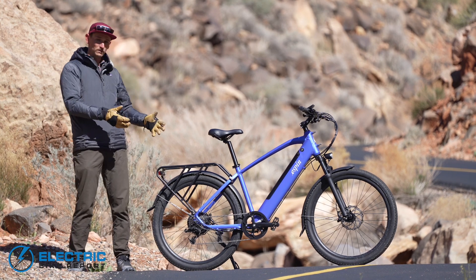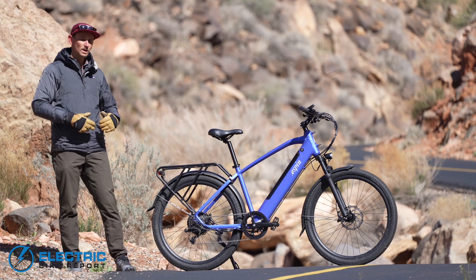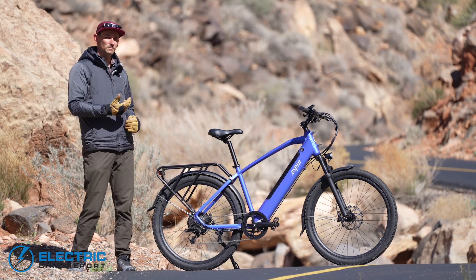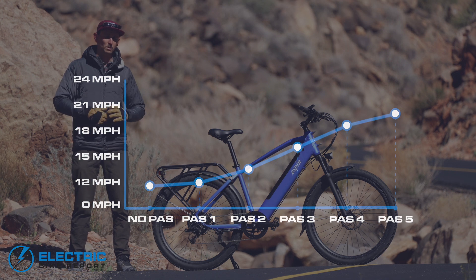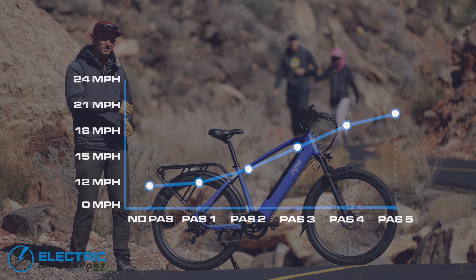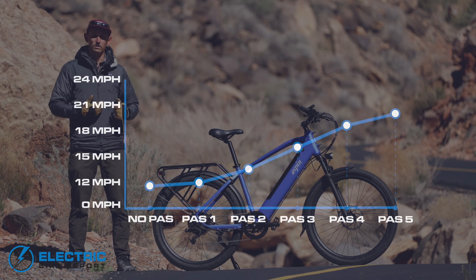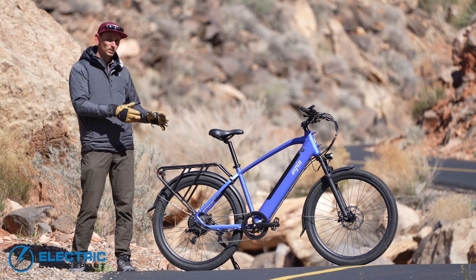The Eastman Sport's 500 watt rear motor is very fun — it's got a lot of pep, creates 65 newton meters of torque which helps its ability to climb hills. Moreover, it's just a quick feeling bike. It's limited to class two speeds, so 20 miles an hour in both pedal assist and with its thumb throttle. It also comes with five levels of pedal assist. In our tests on the electric bike report test circuit, with no motor help we saw an average speed of about 11 miles an hour, which gives an indication that this bike doesn't pedal super efficiently without the motor. From there, we saw really nice measured increases in speed all the way up to 20 miles an hour in PAS-5. It does a really good job of using its power. It's a fun, quick bike and that motor is going to serve pretty much anybody well.